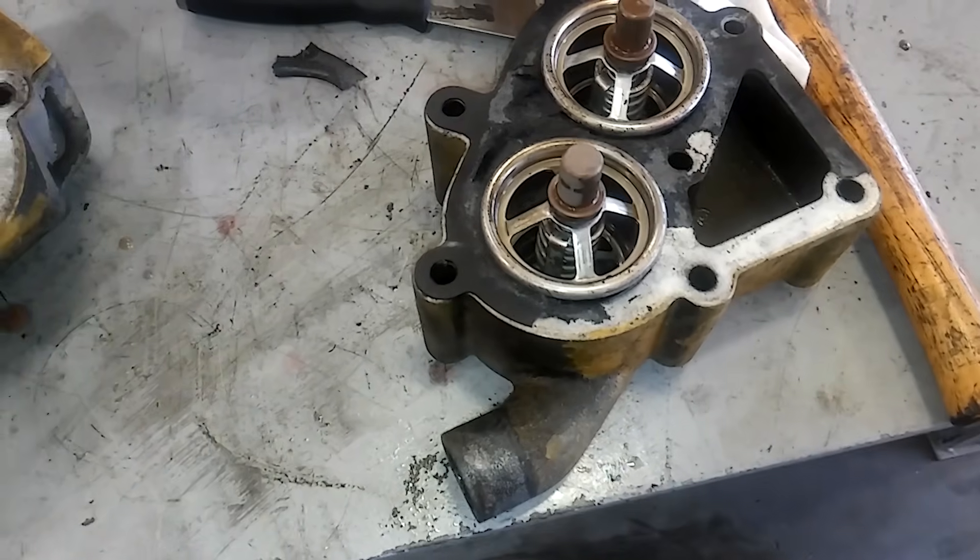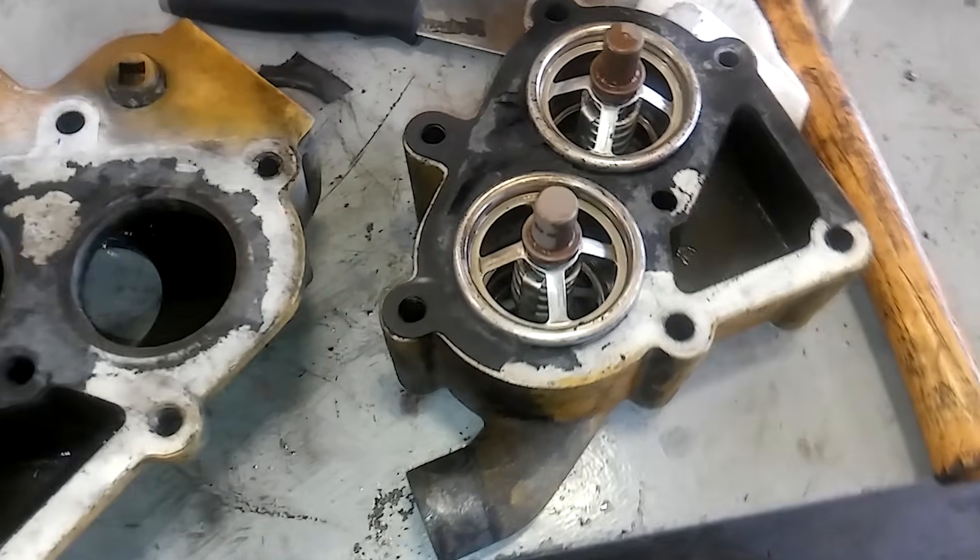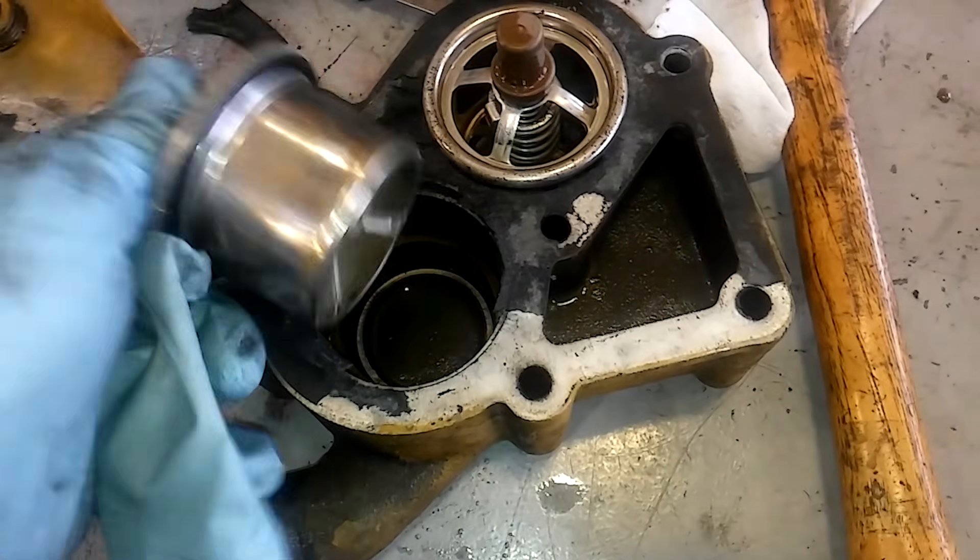Why is that? It's kind of a complex subject, but I think there is a basic misunderstanding of the purpose of a thermostat and why it's very important. A thermostat is one of the cheapest components in your engine, at least compared to a piston, turbocharger, fuel injector, or cylinder head. But it can cost you thousands of dollars if it either fails or you're running the wrong one. A thermostat does not help keep your engine cool — the idea of running a cooler one to keep your engine cooler is fundamentally backwards from the purpose of a thermostat, or temperature regulator as Caterpillar calls it. The purpose of a thermostat is not to help keep your engine cool, but to help keep your engine hot.